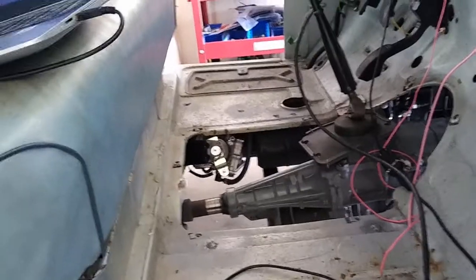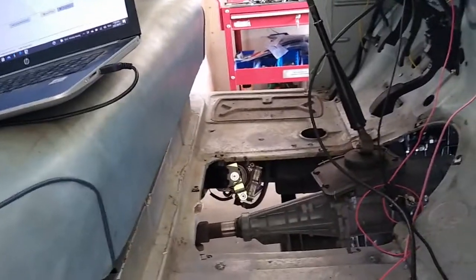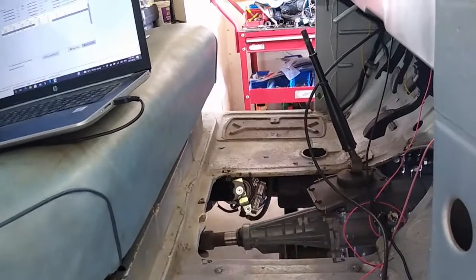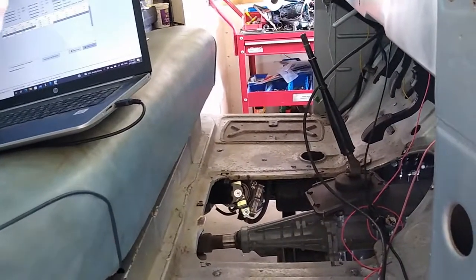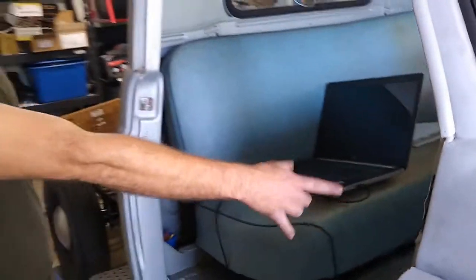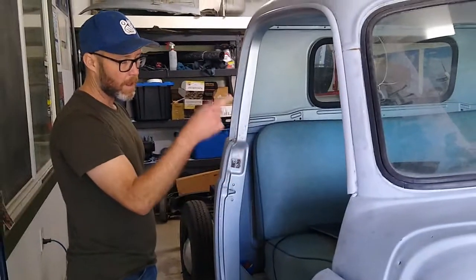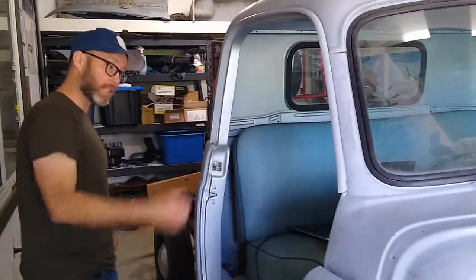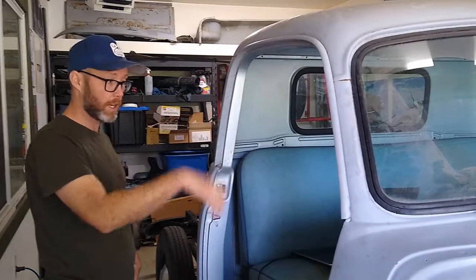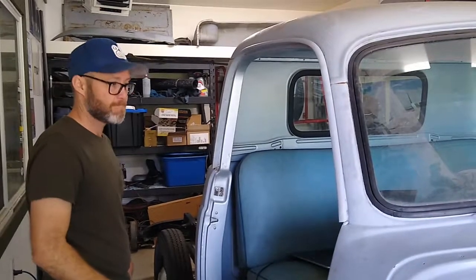I just replaced the fluid in the transmission and did the fluid in the rear differential, because with this kit you're actually using the gears. The original 1954 transmission was a three-in-the-tree — impossible to drive, and the torque from the motor would have grenaded it. So we've got a Ford — actually a Mazda — five-speed, and that'll allow me to get to highway speed. You won't use all those gears though — you can literally leave it in third gear and just go, don't even need the clutch. When you hit the highway, put it in fifth. I do have a brand new clutch in there and it still makes shifting nicer — you can drive it like a truck through all the gears if you want.